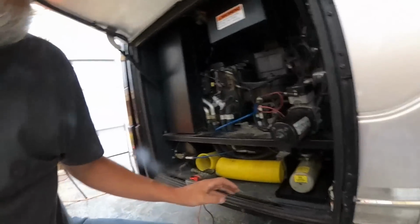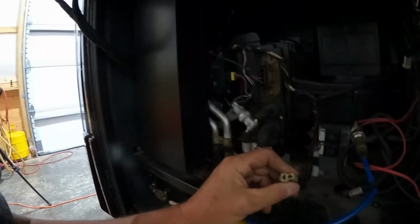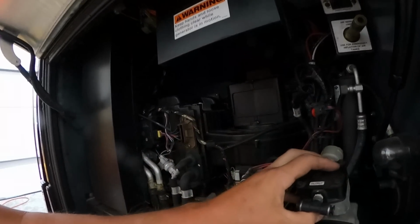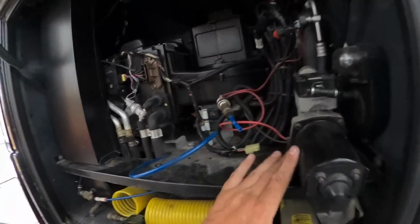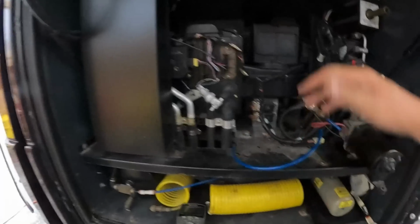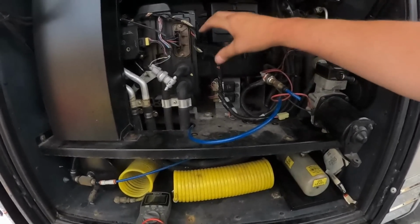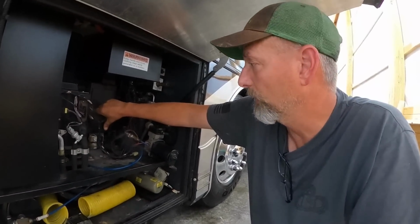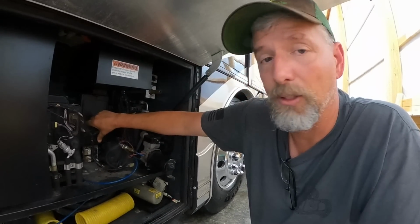So anyway, I fixed the light behind the dash, didn't see the fuse, so now I'm in here. And I've tested out the blower motor power, and it's got 11 volts going to it. So I've disconnected the lines and started taking the little compressor out of the way, so that I can start getting access to the motor, because I've got to pull all this out to get the motor out. And then figure out what motor it is and get it ordered, I guess. And so it's gonna turn into a big job.